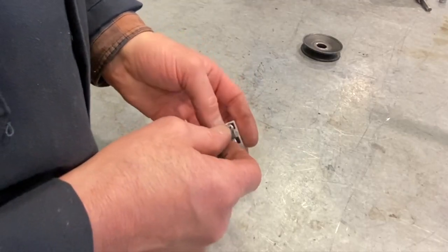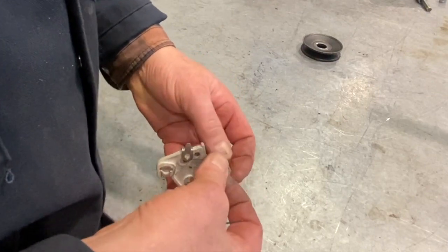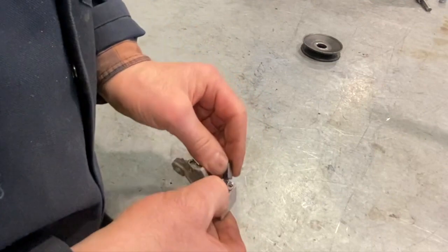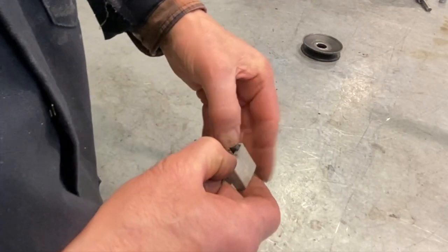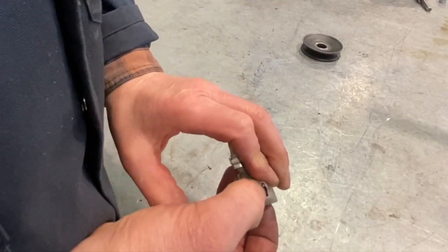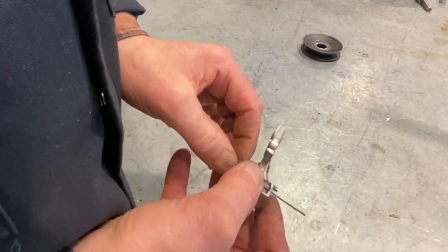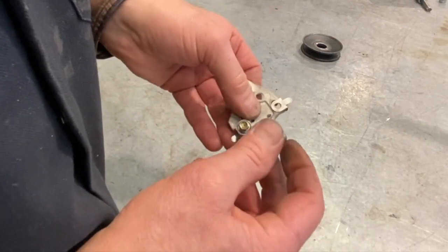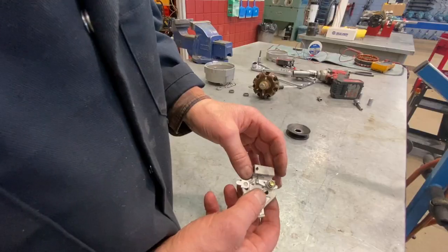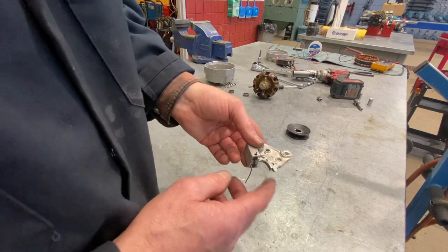When putting brushes back into a Chevrolet brush assembly, you're going to need a piece of wire. You'll push your brush in with your finger and run a little wire through one hole of the brush assembly, then load the other brush the same way. Run the wire over top of the brush and poke it through the other side of the brush assembly — a little tricky, but it works really well once you've got it in there. We're going to use that wire to reassemble this back into the alternator housing at the back, and the wire will come out the back of the housing. Once fully assembled, we pull out the wire and the brushes will be loaded up against the rotor inside.